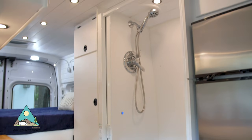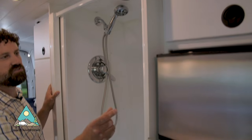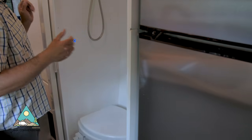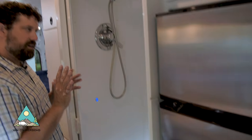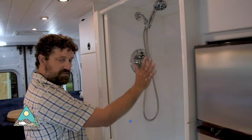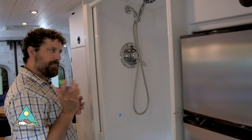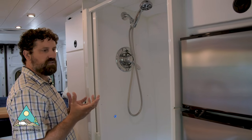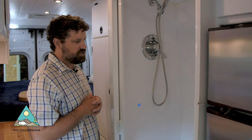In the shower area, I build these showers out of one-piece half-inch vinyl PVC. What I like about that is it lets me secure it right to the frame and it contours to the frame of the van, allowing you to get the maximum amount of space — because these vans are not very wide and you really need to maximize your width.